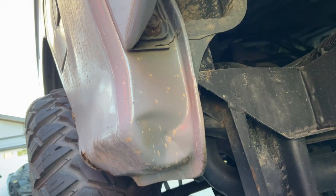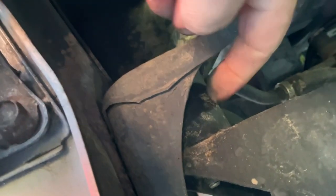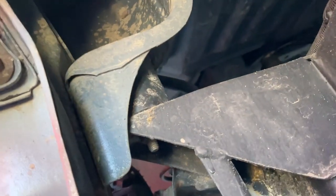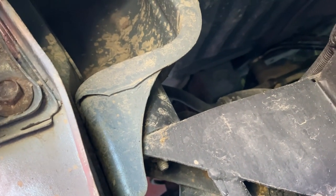Looking in the left rear of the cab, you can just see right in here is another two-inch spacer, and again another one on the box. These were commercially available — very cheap two-inch spacers you can just buy. They're not metal; they're like a hard resin or hard plastic — a proper lift kit part. The cab spacers I got custom made because of the diameters — one is about two-inch diameter and the one forward is about one-and-a-half-inch diameter, as it's a fairly tight fit.